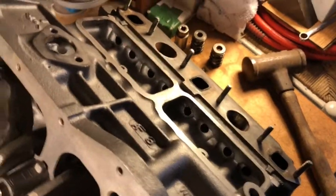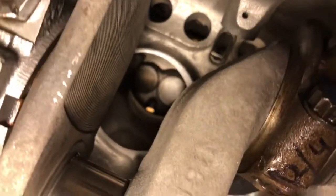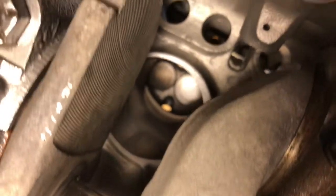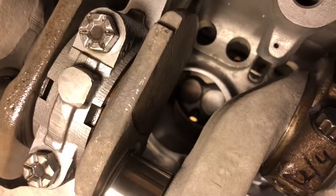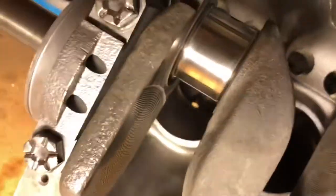The head still has small valves, but these are monster sizes compared to what you'd have to do to a small-bore head. Looking at the combustion chamber, you can see the intake and exhaust valves. We've moved the cylinders so much that you can almost open the exhausts without touching the cylinder wall — but it just isn't mathematically possible without some super exotic machining on the block, and that isn't worth it. The goal is not to spend silly money building a smaller engine, but to take it with available parts and improve it for real-world use.